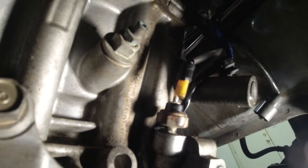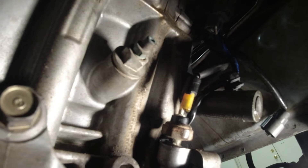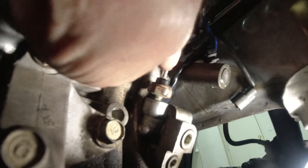There is the oil sending unit. The connector had a rubber boot with some electrical tape on it, and it turned hard as a rock, so trying to chisel away at that to find the actual connector took a long time. But there is the connector unplugged, and I'm about to take it out. Right there is the tip of the pressure sensor, the oil pressure. Now I've got to unscrew that and screw in a new one.